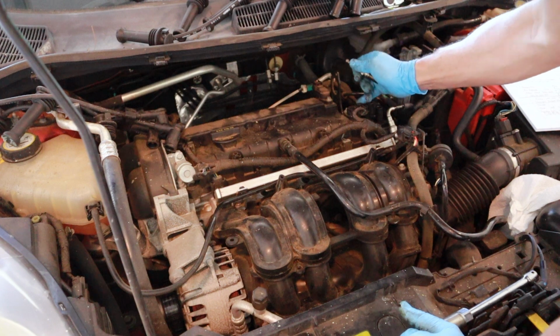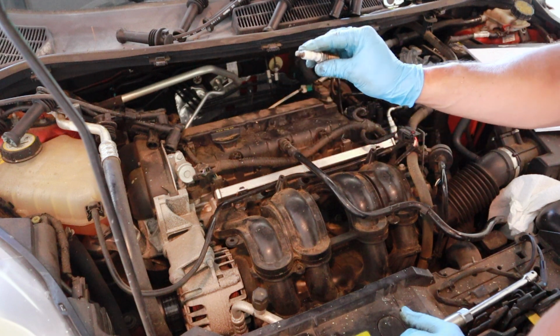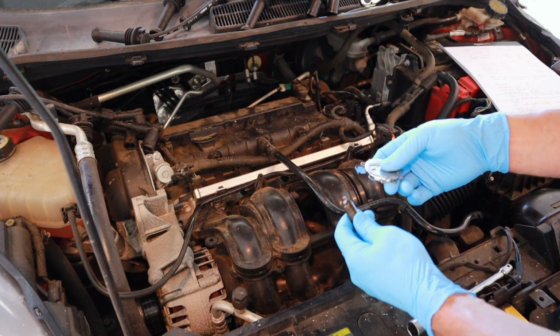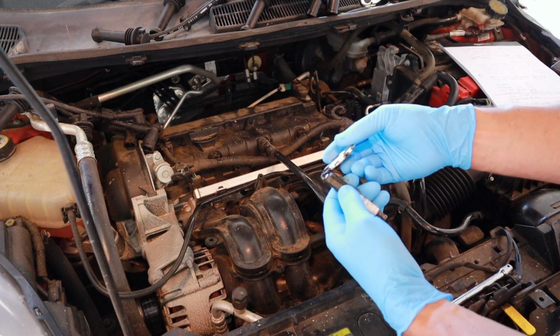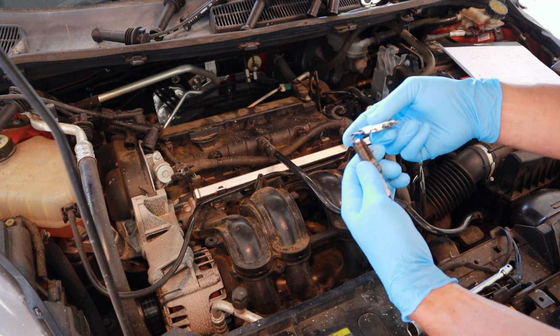So now, to go along with our new ignition coil and our new wires, I'm going to see if I can replace these Autolite plugs with some good Motorcraft Iridium spark plugs that are gapped correctly. Now I'll show you how to gap spark plugs on these old plugs that I'm not going to use anymore. So we checked them, which I already messed with this one, so it's going to be a huge gap. You can see it's got too much of a gap. I'm all the way to 55, way too big.